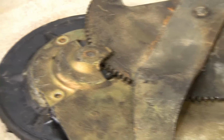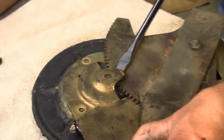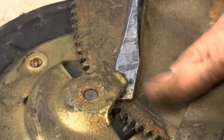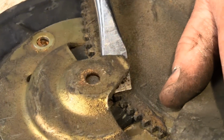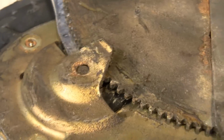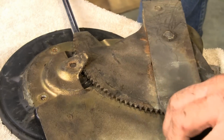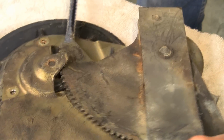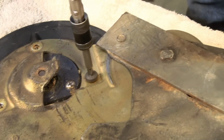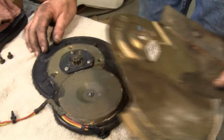Now, because this one has a strip nut plate, we're going to go ahead and show you how you can just bend this tab. Just bend it up. It's soft. And then what we'll do is we'll pull the gear up off of the motor itself and work your regulator around so that you're to that screw. And we'll separate the motor from the regulator.